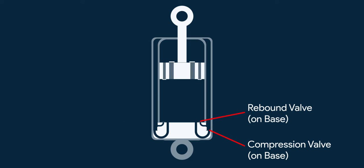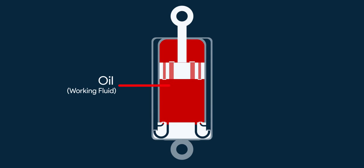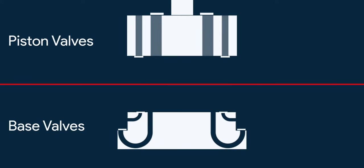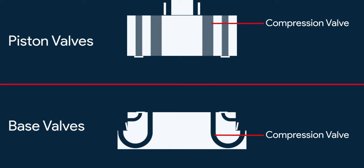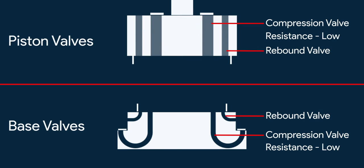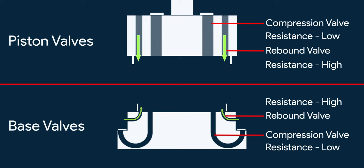The base valve has compression valves which open at compression and rebound valves which open at rebound stroke. The outer tube and inner tube form an oil chamber between them, so all the excess oil can remain in it. The resistance to compression or rebound is dependent upon the valves of the shock absorber. Generally, the valves which allow fluid flow at compression have bigger openings, so fluid flow is easier, offering less resistance. While flow at rebound is made difficult by having fewer valves or valves with smaller openings, which allow better damping of the spring vibration.